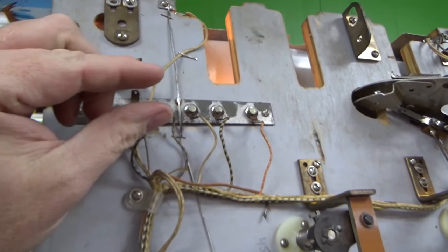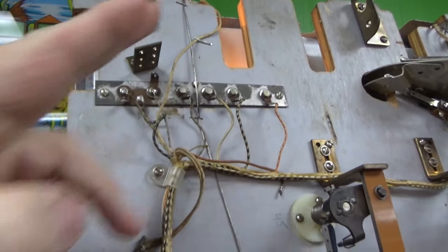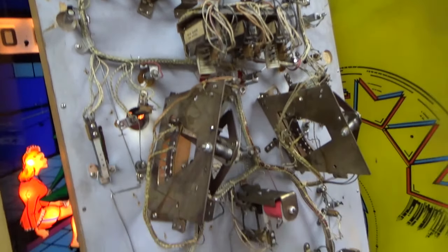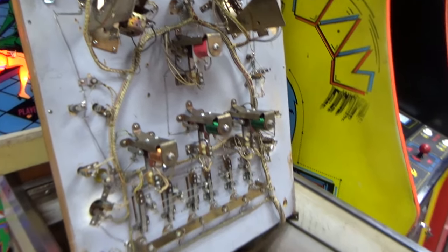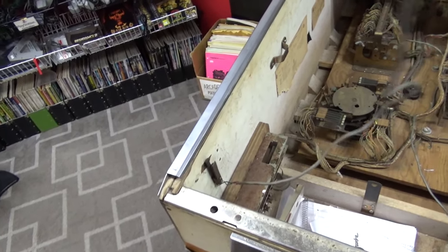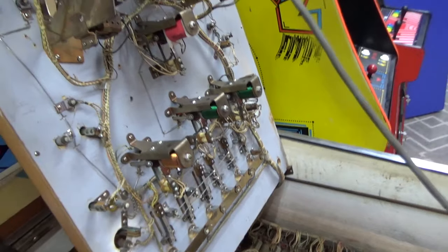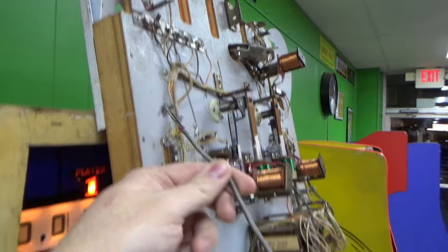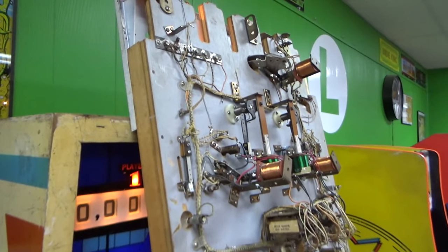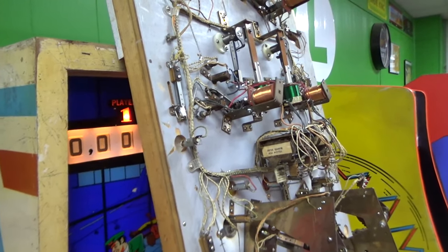If you had the little metal thing it originally had, whenever you lay the playfield down there may be a gap between the metal thing and the switch, so you had to push the flipper and it has to move quite a bit before it hits the switch. The easy way to fix that is to just bend the switch a little bit, like you bend all the other switches in the game — but for whatever reason, people like to go way out of their way to reinvent the wheel. So they soldered telephone wire — this must be Cat 1 — to the flippers. You can see the problem: there's no way to remove the playfield with it like that, and you can't even set the playfield up with it like that. When the customer brought it to me, one of these was already broken.